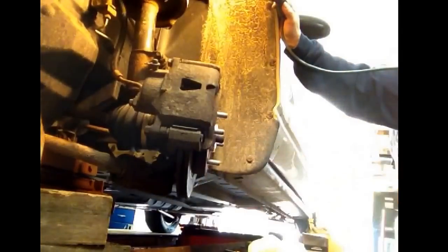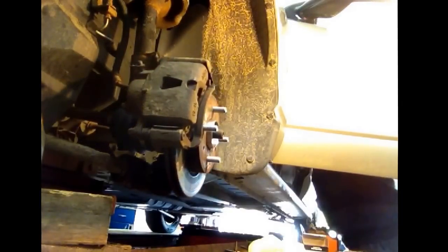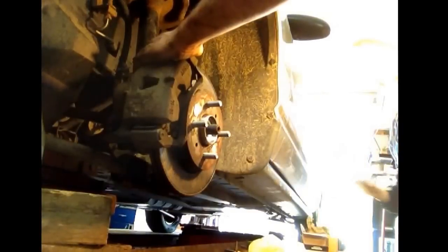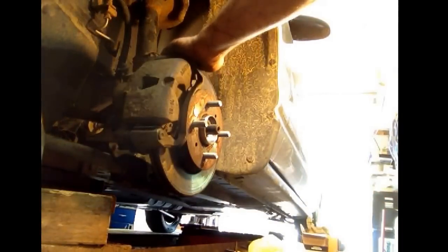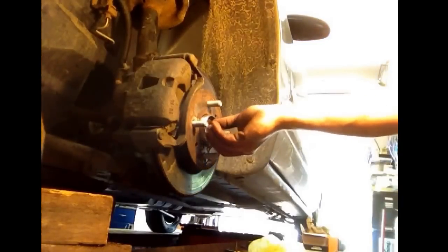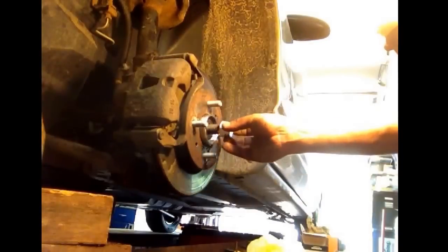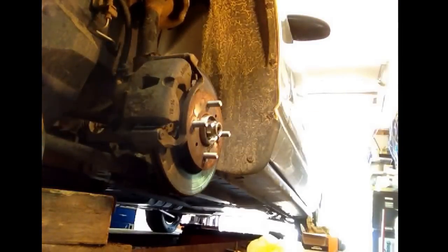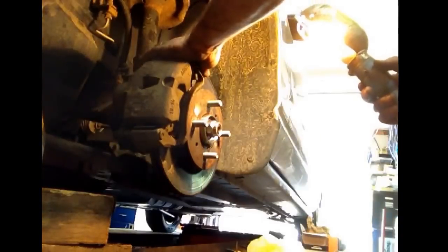That's back together — looks like we're all set here. I'm going to have my wife straighten the steering wheel out on it. I'll take a second to show you some of the tools I've got laid out here so you can have an idea of what I've been using. I used regular wrenches — a lot of this was metric of course. I used vice grips to pull out the cotter pins, a really big socket set for pulling that main nut off. The clip ring pliers were used for pulling the clip off the back. I did have to use a puller to pull a couple of the pieces off. I also made a mistake — I put the bearing on the wrong piece first, so I had to use a hammer puller to pull it back off. You have to be careful doing that. The bearings have to be pulled off straight — you can't tap one side then the other.